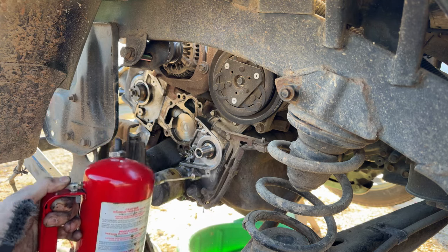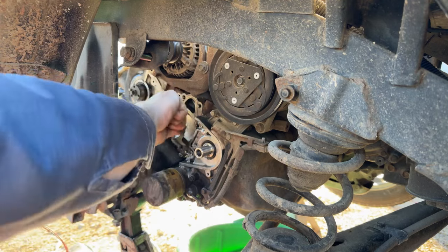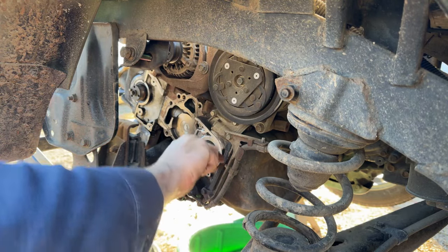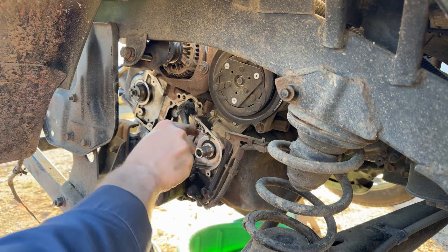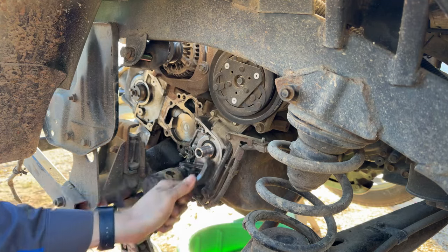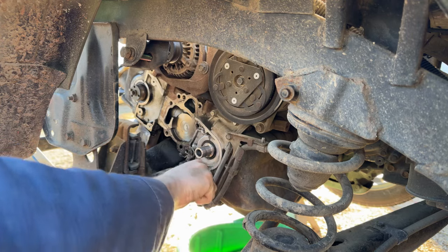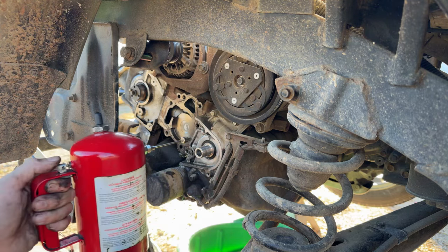Clean up the oil on this oil pump where it's been leaking. Probably gonna go ahead and change his oil and get this stupid Fram filter off here. We got some black Tokyo Roki Japanese import K truck filters in stock, so probably go ahead and do that for him, not knowing how long it's been since the oil was changed. But while we're doing everything else, you know, might as well. Judging from the dirt and debris on this Fram oil filter, at least it's been a while.